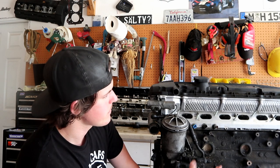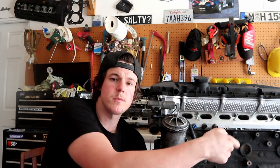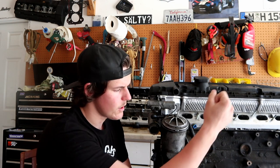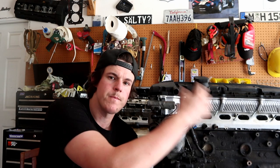Same thing with the PCV valve itself dripping. It can drip some liquid oil, just a tiny bit. And then the hose going down to the dipstick can crack and cause leaks. And the dipstick tube itself has a little O-ring at the base of the oil pan that seals it up, and that can leak as well. The side of the dipstick does bolt to the intake manifold, so you don't have to pull the manifold off. You just unbolt it from there, unclip the line from the bottom of the PCV system and slide the dipstick out to the top. You can replace the O-ring, put a little bit of grease on there, clean the oil pan, and stuff it back in there. And they do sell PCV rebuild kits for, I think, a couple hundred bucks, probably under that, and you can rebuild the entire PCV system lines and the valve itself.